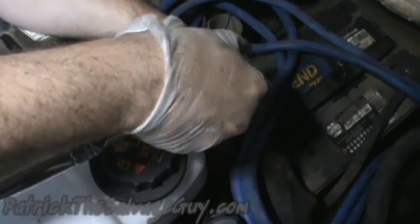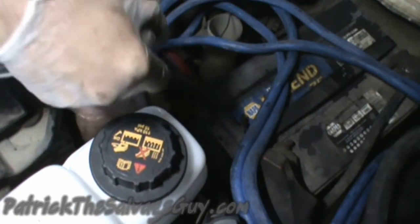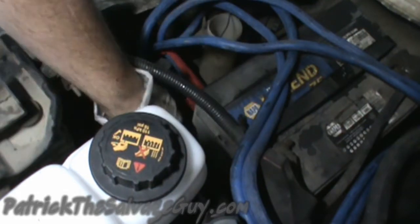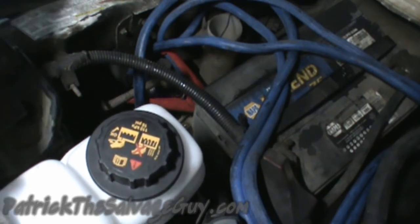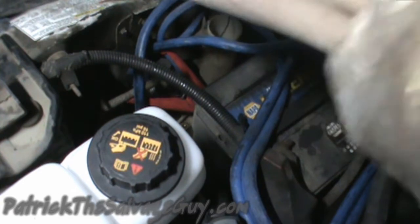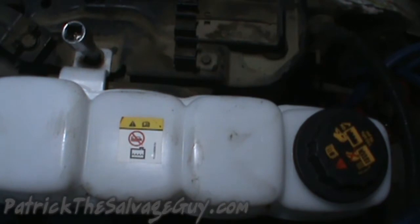Now, don't overtighten these bolts when putting them back in. But if you get diesel into your coolant, it will destroy all the plastics on your cooling system, and you want to flush that contaminant out. It'll ruin stuff like this coolant tank, maybe your hoses. The earlier you catch that, the better. Don't let it go. You'll just be sorry. So I'm putting this third bolt back in.